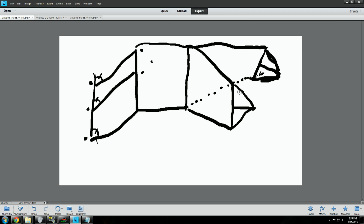But no matter what, the go-to thing for this independent front suspension is you always put your center node right here, and then you use your hydros off of that center node to this. So you'll have your hydros coming down like this, and that's what'll steer your car. Now, if you do an exactly geometrically the same one, like this one over here, your geometry is going to stay exactly the same when it's down low and when it's up high. So even when this is all the way compressed, your axle is going to have the same exact toe, caster, and camber as when it's down low.